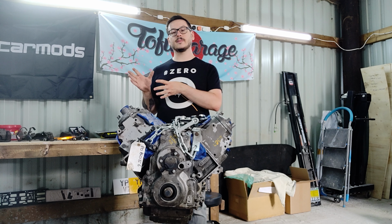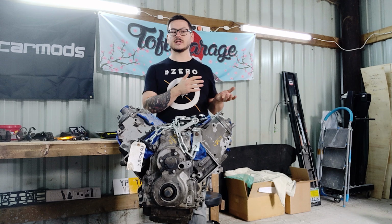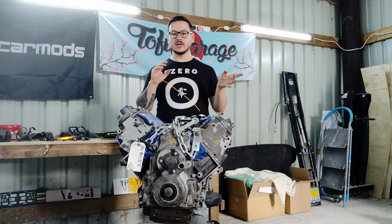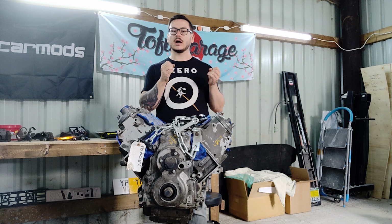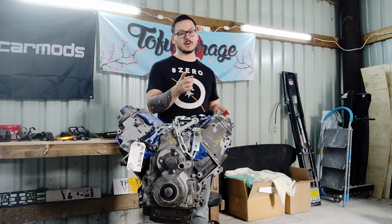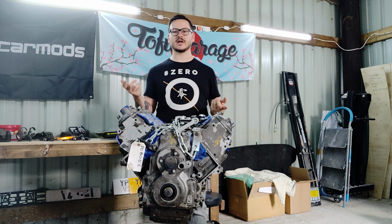So often the car-based engines are aluminium, nice and lightweight, and the truck-based engines are iron. And they have their pros and cons. The aluminium, as I said, is very lightweight. The iron is very, very strong, but the iron's heavier, but cheaper. And as you can imagine, when you come into deciding an engine swap, they're the kind of factors you keep in mind.